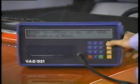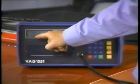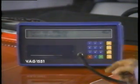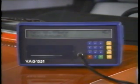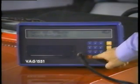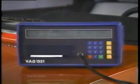Each fault can be displayed by continuing to push the arrow button until the select function XX display is shown. If you would like the contents of the fault memory printed, simply push the print button and repeat the procedure, and the contents of the memory will now be printed out.